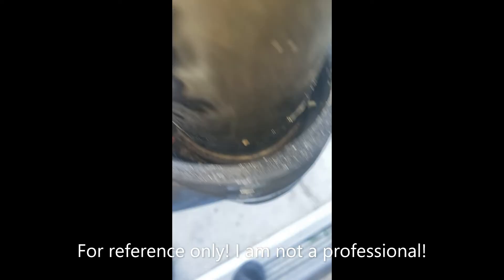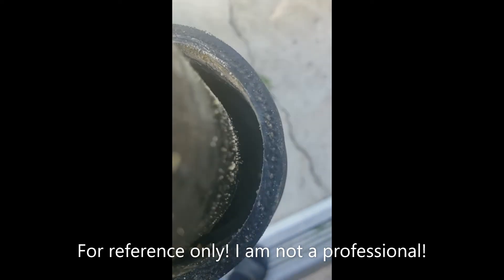You see, this is pretty bad. You can see all three of the coolant holes are clogged by small tiny rocks. This is why your ski's exhaust is overheating.